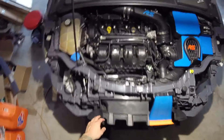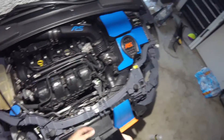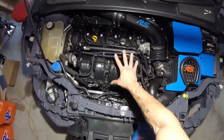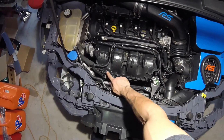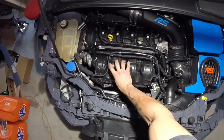As you can see I got the front end pulled off the car. What I'm doing right now is in order to get my aux fuel, my tune, big turbo, and everything — in order to get it over 30 PSI — I have to take what my split second injector right now is triggered off of: my sensor on the intake manifold.